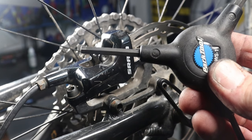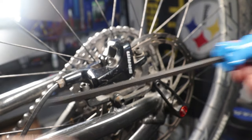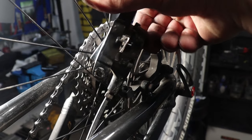I am now going to take my 5mm Allen wrench and remove the caliper retaining bolts. A ball end screwdriver will speed up the process, although it is not a necessity. Just lift the caliper off and look where the brake pads came out of.